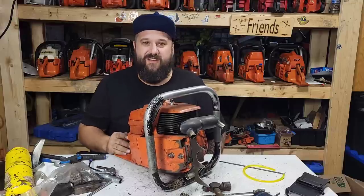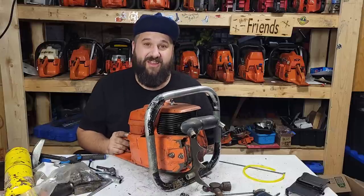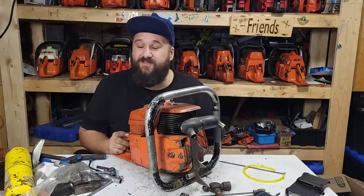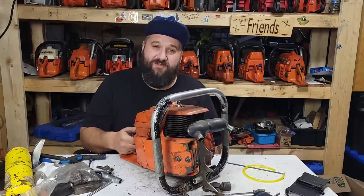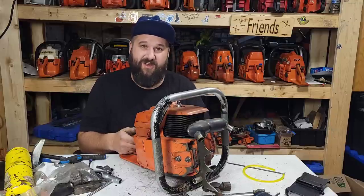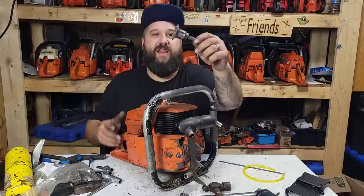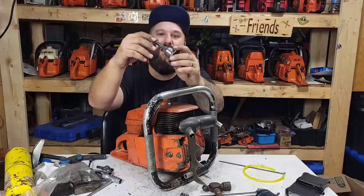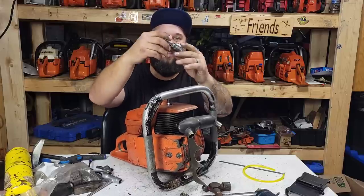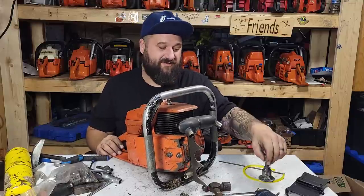Thanks for watching. If you have an old saw and you can't find the coil, it's behind the flywheel — it's probably a Bosch and often they don't work. I'll look on the internet and see if I can find a Bosch ignition for an L65 or L77. You can make pullers — just a flat washer, a piece of pipe, a nut and a bolt, and away you go. That worked like a charm. Thanks for watching, take it easy.